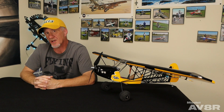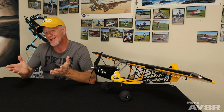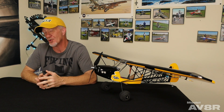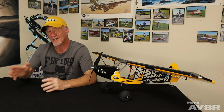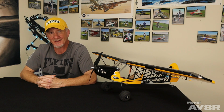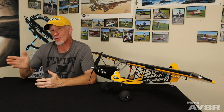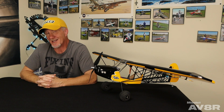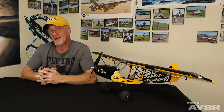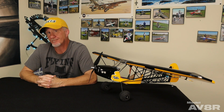So the first thing I wanted to address was the fact that I needed more right rudder trim than I felt like I should be using to make the airplane track straight. And obviously I trimmed it at cruising throttle, so it was causing me a little bit of an issue under takeoff power. Initially the airplane was wanting to go right because that rudder trim was a lot more effective with a lot more power. And I just didn't like that. I felt like maybe changing the thrust angle might correct that problem and eliminate the need for so much rudder trim. So we put a single washer between the firewall and the mount and the top left mounting bolt, and that gave us more down and right thrust, hopefully to eliminate the need for that trim.